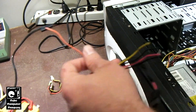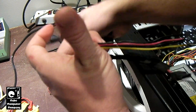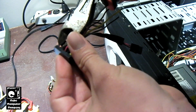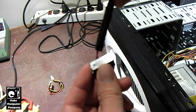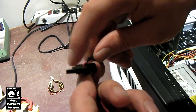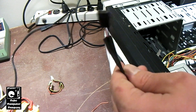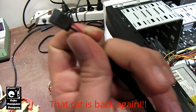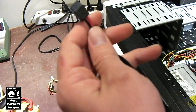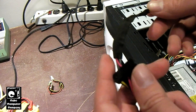So what we're going to do is go ahead and snip off the orange wire right about here. We're not going to need it, so just snip it down as close as you can to the connector. This donor lead has a standard SATA power connector, and also this little connector here — this is a 5-volt only connector that would actually power a slim laptop optical drive installed on a desktop. I'm going to leave that on there although we're not going to need it.